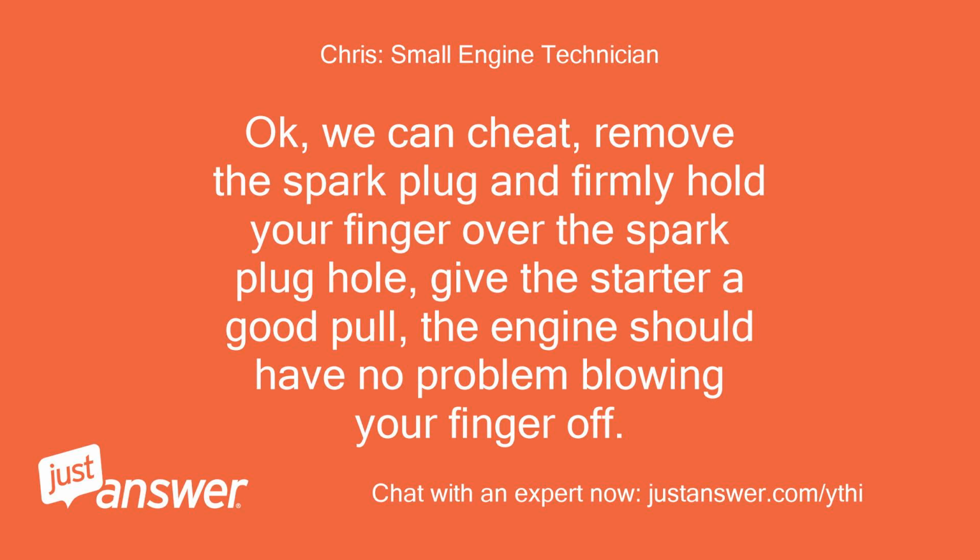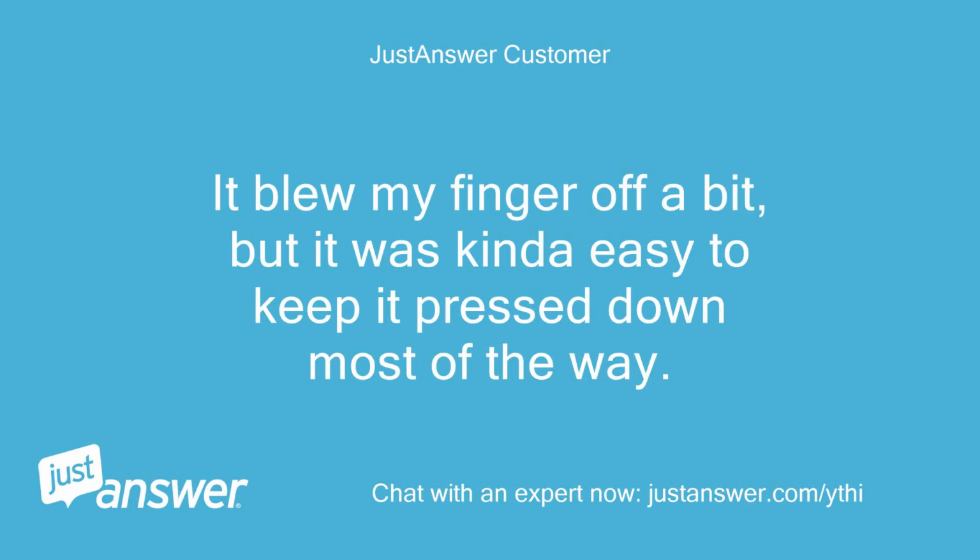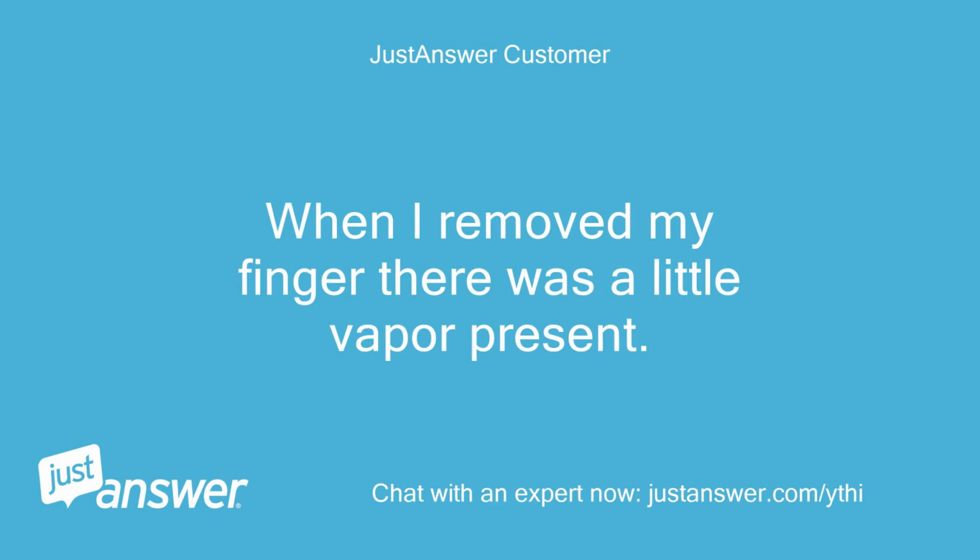Okay, we can cheat. Remove the spark plug and firmly hold your finger over the spark plug hole. Give the starter a good pull. The engine should have no problem blowing your finger off. FYI, keep the spark plug wire away from your hand or you'll get bit. It blew my finger off a bit, but it was kinda easy to keep it pressed down most of the way. When I removed my finger, there was a little vapor present.